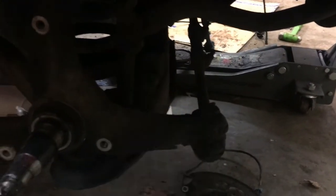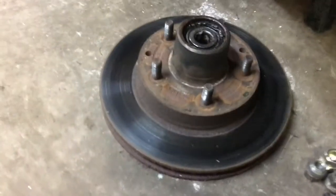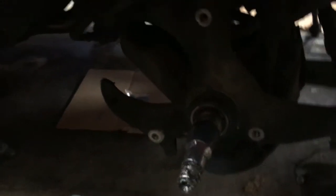Here's the old spindle, and this is how far I am on the other side. It's a 22-millimeter nut and a 24 on the bottom for the ball joint once you pull the cotter pin. I think it's a 19 to get the brakes off on an S10 — apparently it takes these stupid Allen heads — and then there's the hub. It works like an old trailer: you just stick a nut and cotter pin on there. It's a pretty easy slash stupid setup.